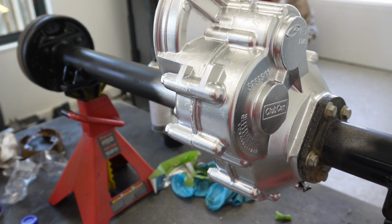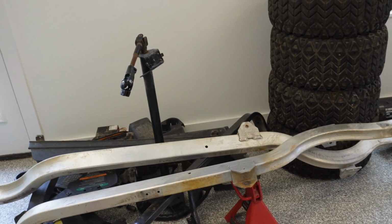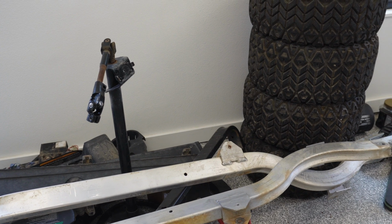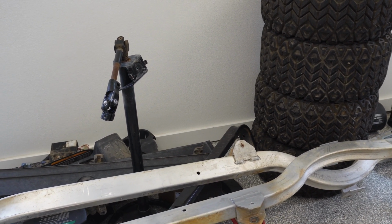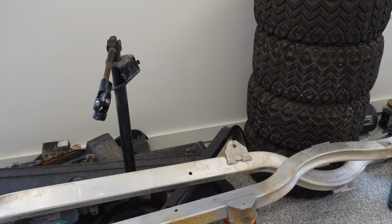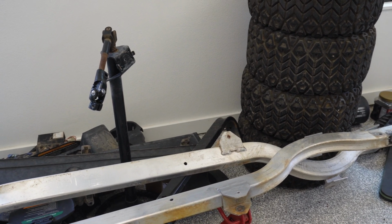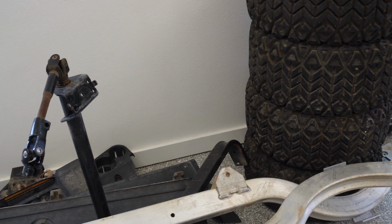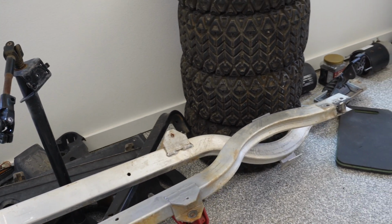It'll be fine for underneath the cart, but for the frame, some of you mentioned powder coating the frame, which is a great idea, but unfortunately it's ridiculously expensive. So what I might do is just do some scuffing with like a Scotch-Brite pad or something, and probably clean this with some aluminum cleaner, and then try to experiment with some different paints, whether it be this, as much as I love the MRO.